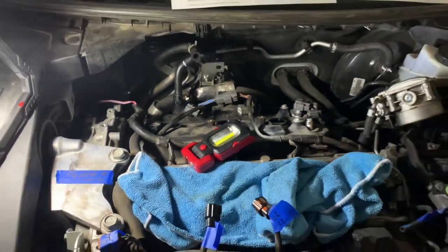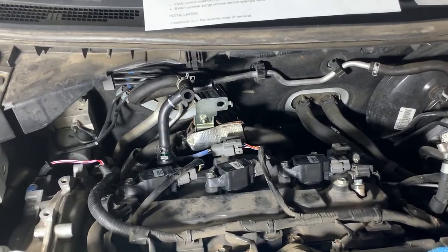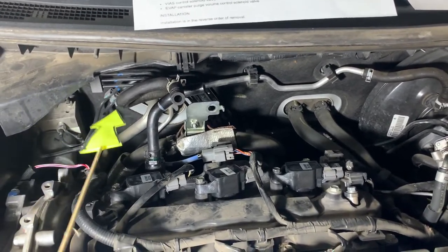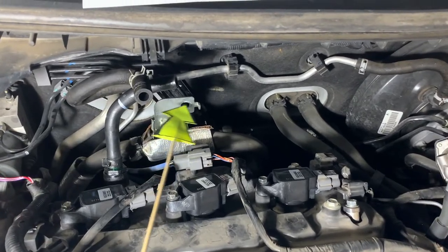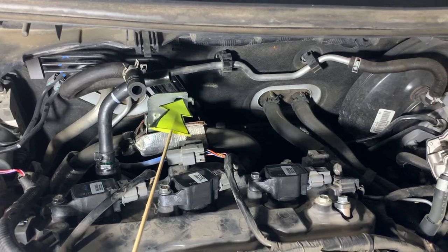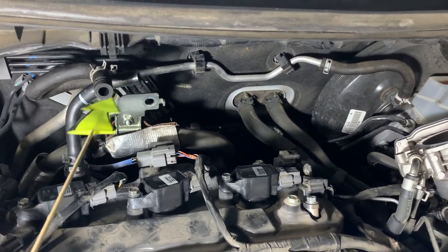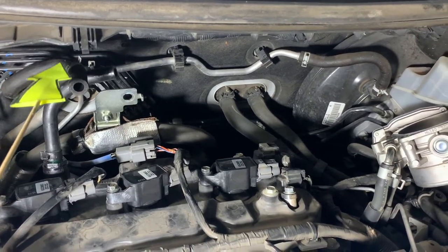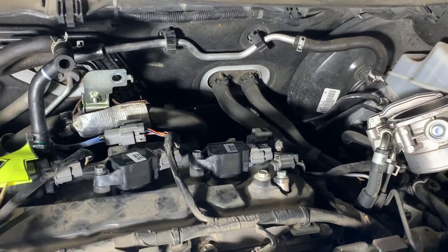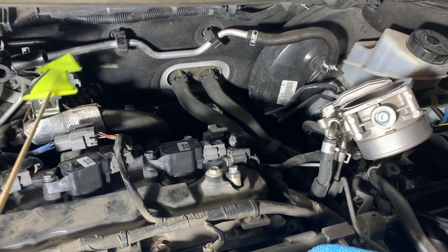Put your new ignition coils on and start putting everything back together. So in the back there, you can kind of get your arm and snake it around. The biggest one you're going to have is that 13 millimeter that goes right into here. Then you got your PCV hose right here. It goes up to a 90. And then your brake booster, probably the easier one to get. But make your clips accessible so you can grip them and move them.